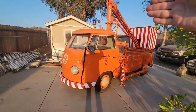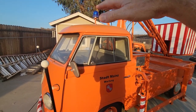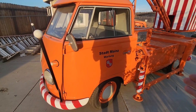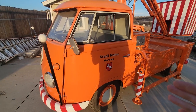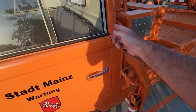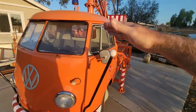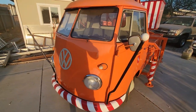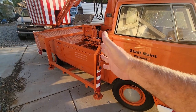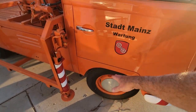In order to support the roof I had to figure out which parts of the sides I needed to save to keep the roof intact. The roof had holes all the way around it — it was really hard to figure out how to save this thing. The rust holes went all the way through; everything should have been replaced. But I had to save enough structure to hold the roof so the doors would fit. The bed was bad too and I had to rebuild all of it, but the cab is much more intricate.